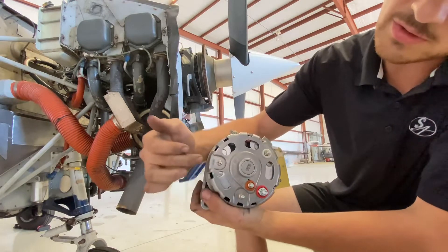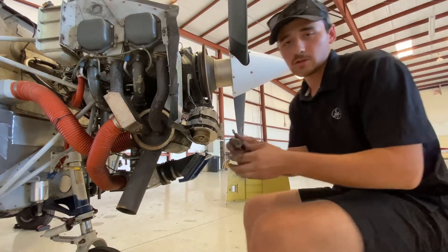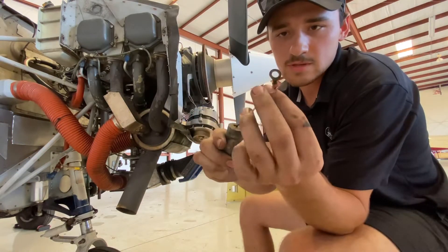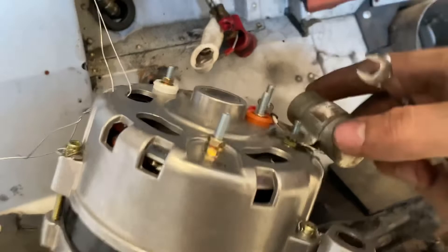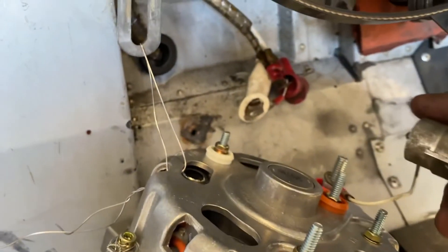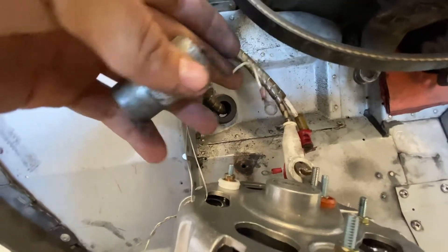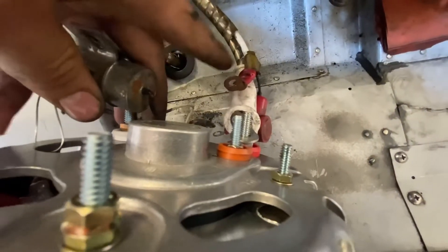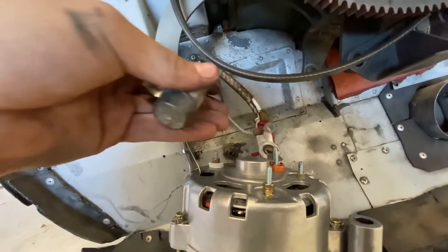This is labeled ground - you got two grounds. Then you got field, and then battery. Now if you guys are wondering where these wires go: this big cable always goes on the battery stud - this is the main battery wire. You can tell it says 'BAT' right there. They had it mounted to the baffling here, which works too. Also a tip: feed the capacitor wire through this boot along with the main battery wire. It just allows better protection, and that way the boot can cover up everything completely and not be half on there.